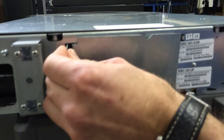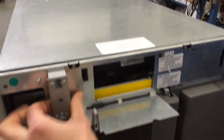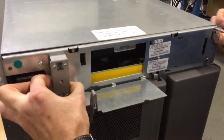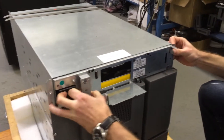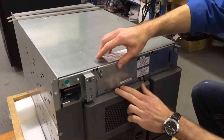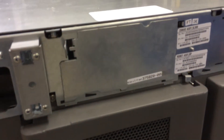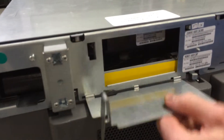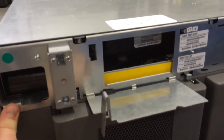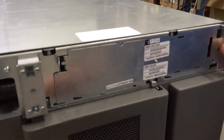Because if you do an improper installation — let me quickly demonstrate what would be improper. If you try to close this door before the face plate is set, then the picker will not be able to move. You can see those two metal tabs are in front of the face, not behind it. This way it will not allow the picker to move properly. So again, I'm just going to release the door, push the picker in, close the door. That's the last step that you do. Everything looks nice and square.